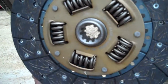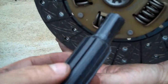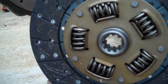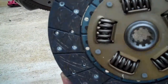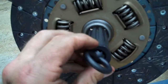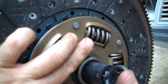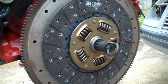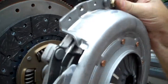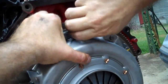Now that the flywheel is tightened down, here's the clutch alignment tool. The Jeep kits sometimes come with two different ones because some 4.0 Jeeps have a smaller pilot bearing depending on the input shaft — there's a difference between the AX15 and AX5 transmissions. This being a 302, here's pretty much your alignment shaft. You simply slide it up inside, bottom it out — it goes up until it seats in the pilot bearing. Push the clutch up flush with the flywheel; there's no right or wrong way as long as your clutch is lined up inside there.